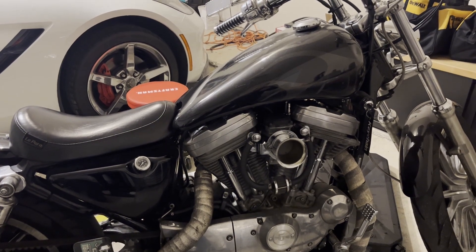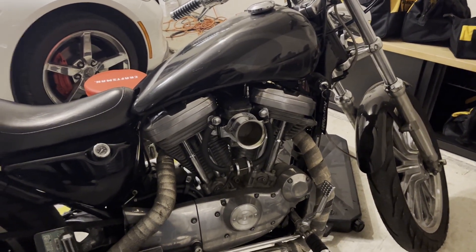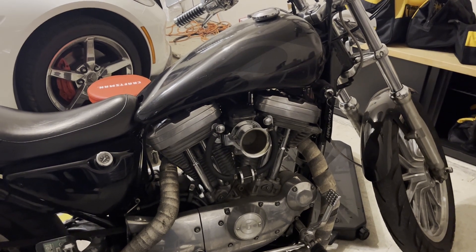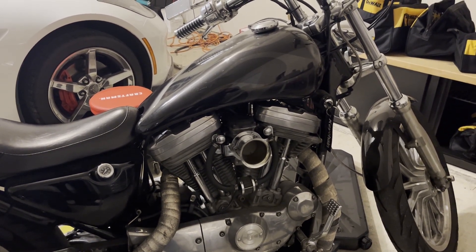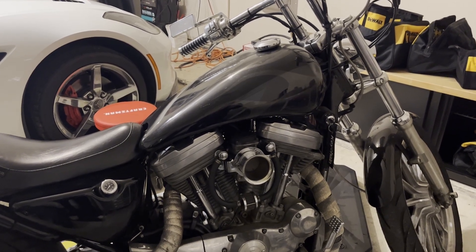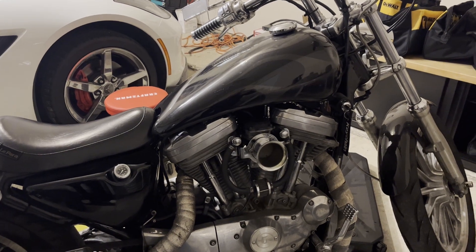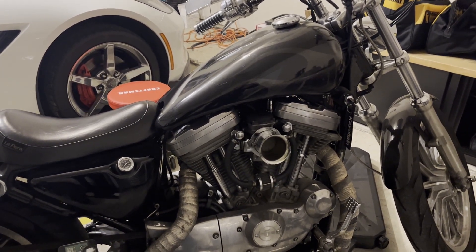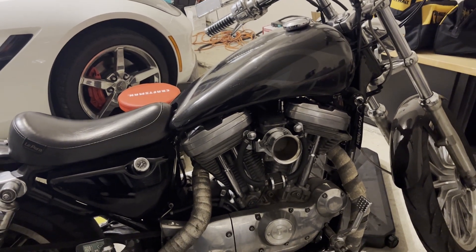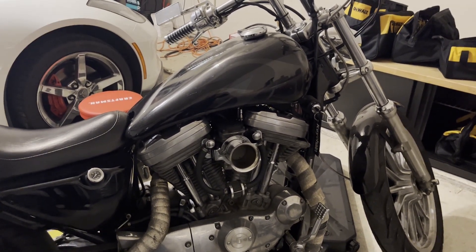Today is just disassembly — drain the fuel, take the carb off, take the exhaust off, drain the tank, pull the tank, take the carb and exhaust off, take the rocker box covers, cylinder heads, and the cylinders themselves. I don't have the new kit yet — it's in the mail. Once it comes it'll be pre-assembled with the pistons in the cylinders, and I just have to add the wrist pins and put circlips on.